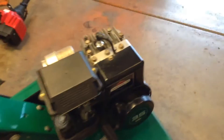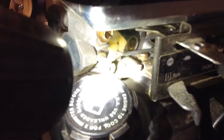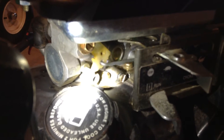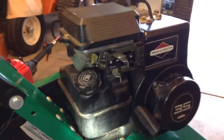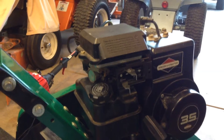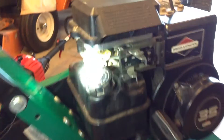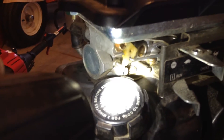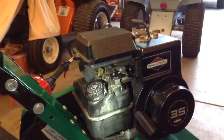3 and a half horse Briggs. It was running kind of choppy and crappy. What I noticed when I was using it is that idle screw right there on the right side — I would adjust it, and then when I was using it, it would walk itself in and lean the motor out. So I got a little piece of a spring and fabbed that up in there, set the carb and adjusted it.